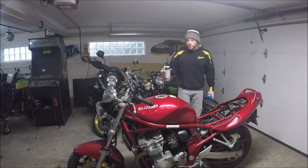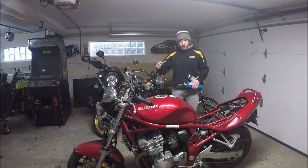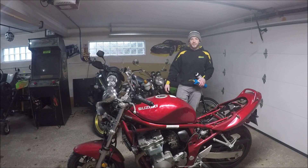How erratic this thing is — but now I'm starting to think maybe there's no issue with the carburetor, maybe it's an issue with a vacuum leak somewhere. That burping was from not having the intake boots and the outlet on the air box tightened down completely. I tightened them down completely and got rid of most of the burping, then I put the petcock vacuum hose back on and the burping came back. So it means I just pushed a little bit on something and started getting all that nonsense again.